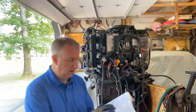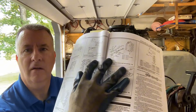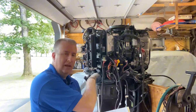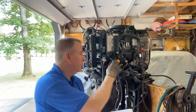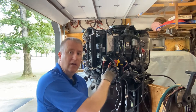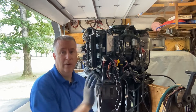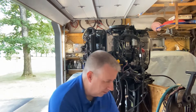So we're looking in the book here, we see the exploded view of the 135 horse — that's this drawing here — and we see there's a poppet valve behind here. I can see it when I sneak my flashlight in there, but we're gonna have to pull this little electrical assembly off with our starter relay and our trim and tilt relays. We're gonna disconnect the battery, which I've already done, but you always want to make sure you don't have anything that could possibly short out.